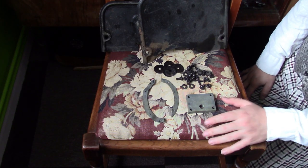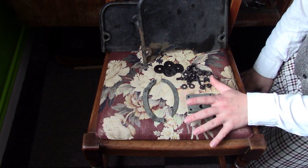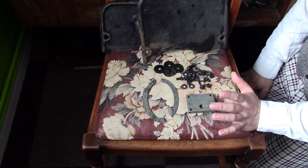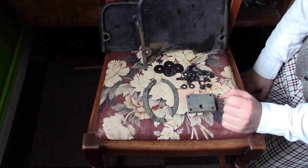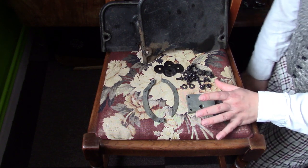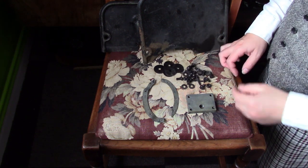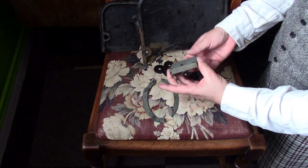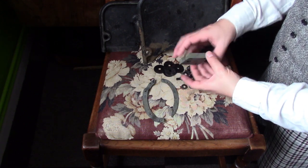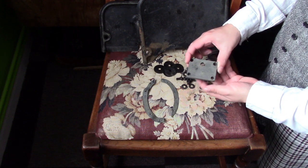Everything is out of the rinse. When you've used this stuff, you want to make sure you rinse everything thoroughly with just some plain water. It helps neutralise all the acid, and then you don't have any problems with the reaction continuing. The other thing I've done is scrub everything with a brass brush, because that's softer than the steel but harder than the rust. You can see some pieces like this have cleaned up basically to bare steel, and they don't flash rust very quickly. You do have a bit of time to work with them before they start doing that.